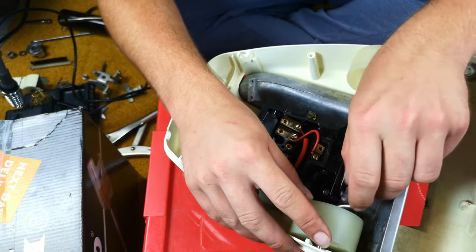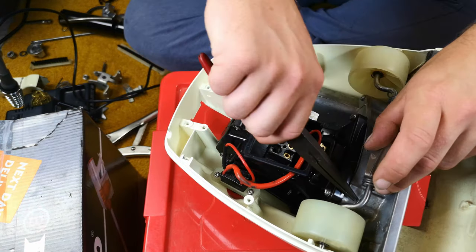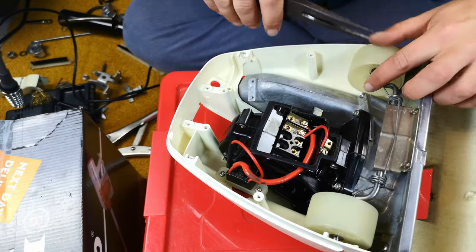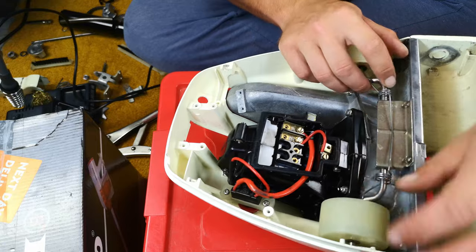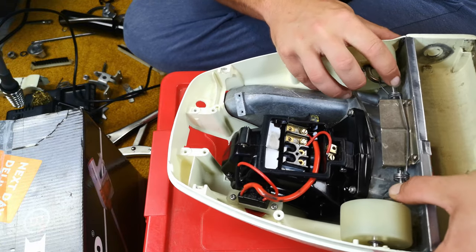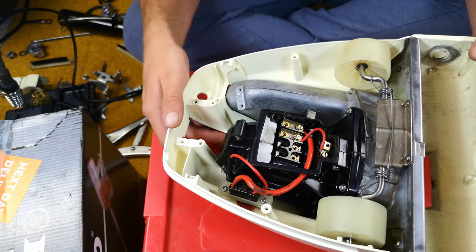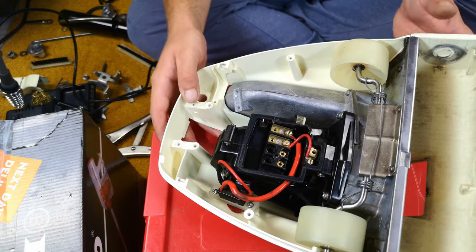Then we can come back to our hoover and attempt to fit it. You've got to try and get the bracket on first — I can see why they got rid of this design, it's not the best. The screws haven't changed — they're still the same front wheel screws. I think I'm going to tension the springs after the bracket's on so I don't drop them right down into the abyss. Using needle-nose pliers — one, two — setting one push down, setting two: beautiful.